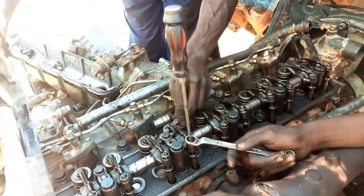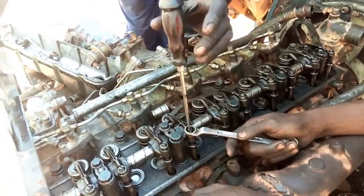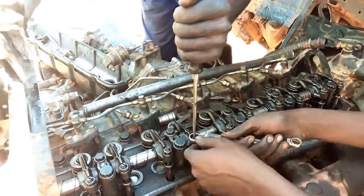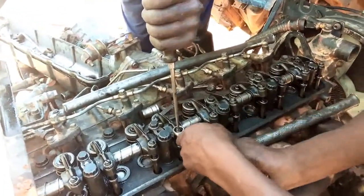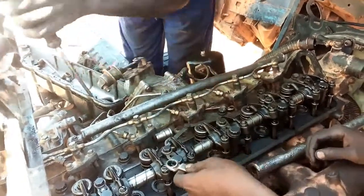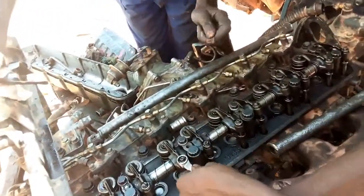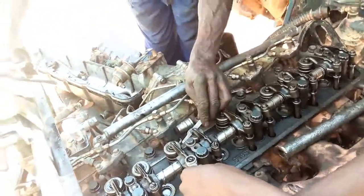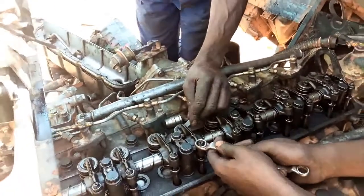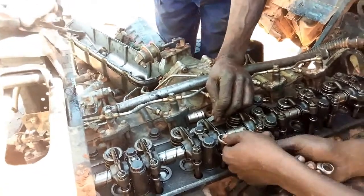Today we are going to adjust the valves, starting with the first 6 valves. As you see on your screen, we are going to regulate starting on the loose ones — that is why we are going to start on the 10th valve. Take your ring spanner, then open by putting your flat screwdriver on it, then open the nut without moving the screwdriver. After opening the nut, also open the screw in order to adjust the clearance between the tappet, the upper part of the rocker arm, and the lower one using the feeler gauge.